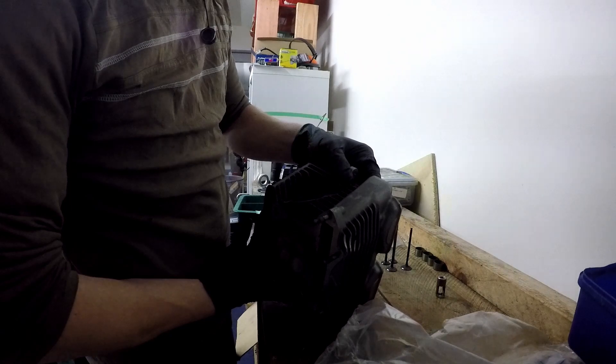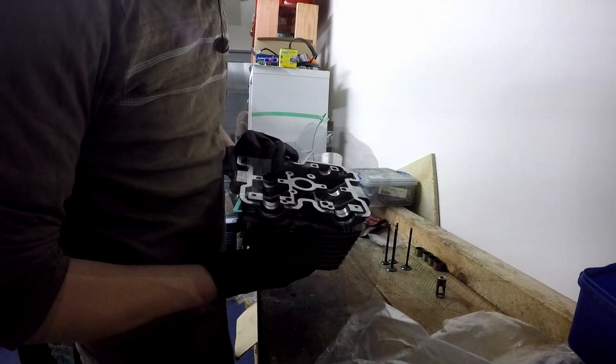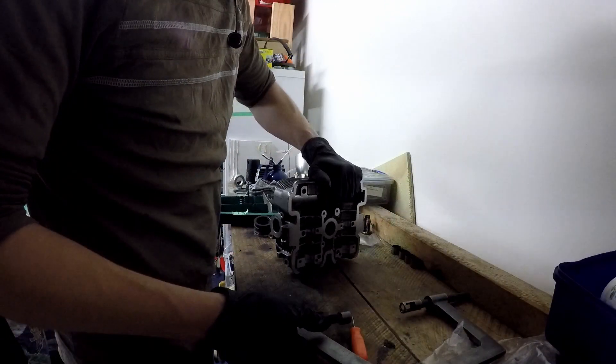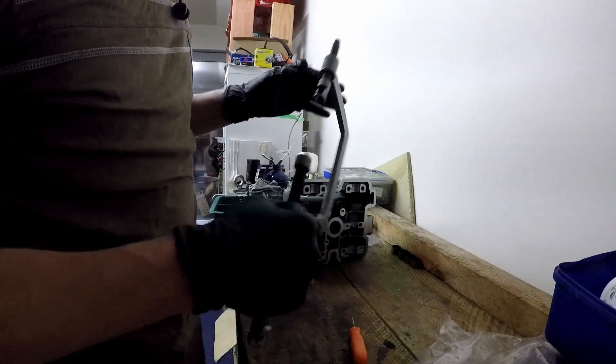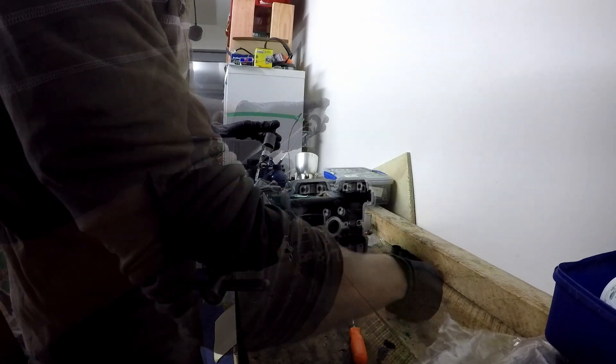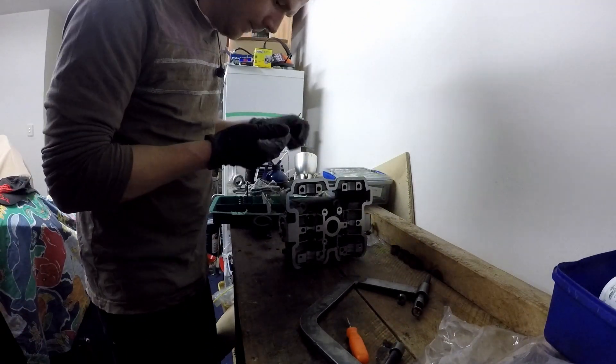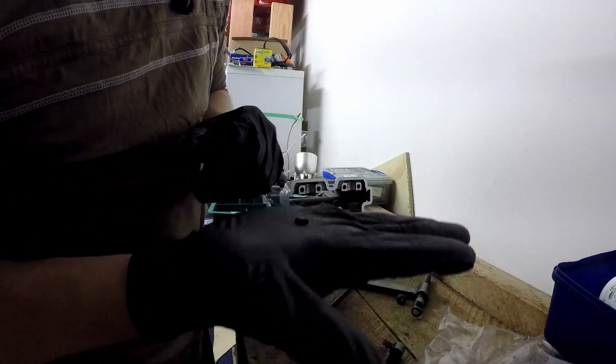Maybe give them a good sand and polish. I'm going to check it in time lapse and strip this thing down. Here are the tools you would need if you're doing this at home yourself. You need a valve spring compressor — it just pushes it together so you can get the collets out, which are the tiniest little things you've ever seen.